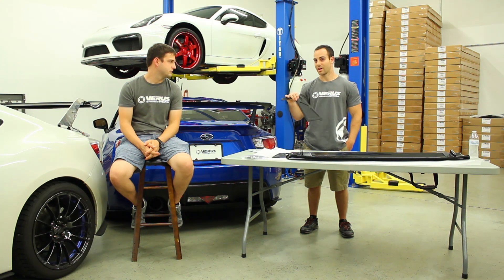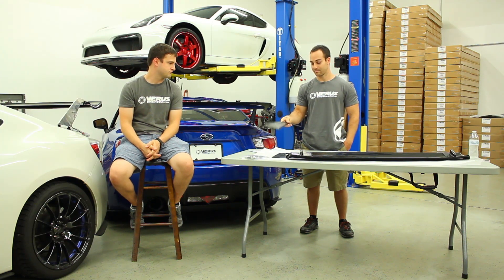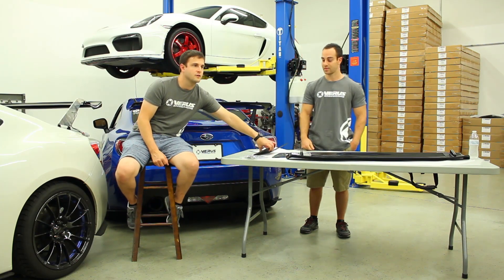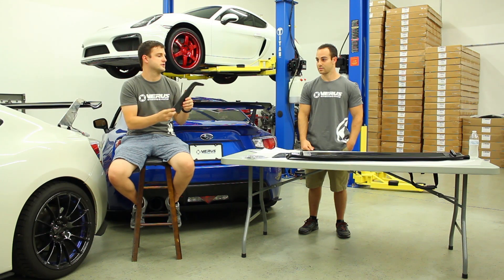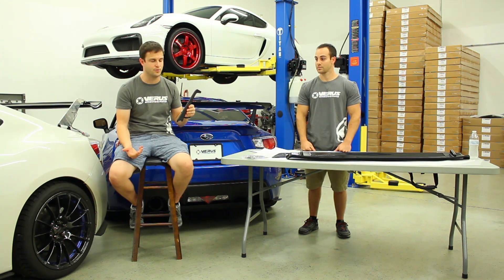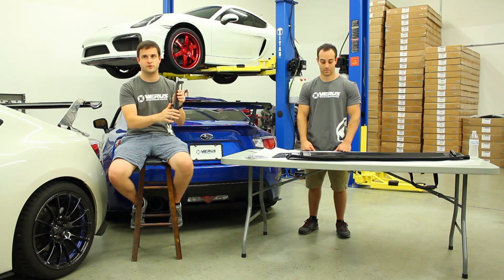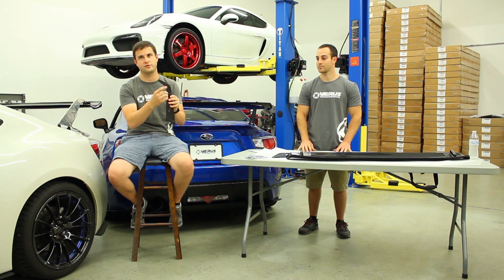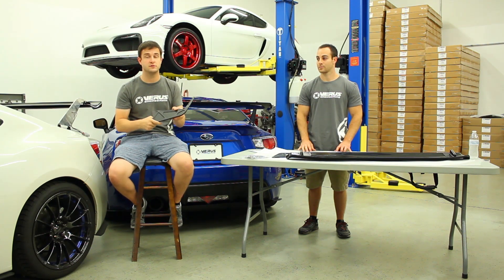Another thing we've been asked is whether the uprights are plastic. They're not — they're 6061 T6 aluminum, hard anodized in a satin finish. They were prototyped in 3D-printed plastic but the production parts are not plastic. If you look at the small details on ours compared to other wings, you'd really start to notice the difference. The front edge is fully radiused and the bracket is knife-edged, making it as close to an airfoil profile as possible. This required a special tool that we had made specifically for this.